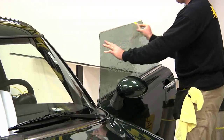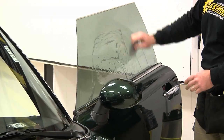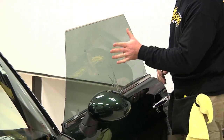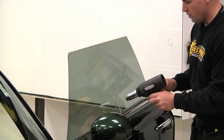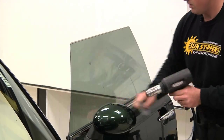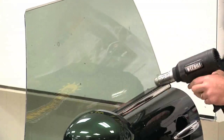I'm going to create what is called tension in the film — in the industry it's called a finger because it comes up from the bottom and kind of points up. The film is a flat surface that comes out of the box, and it has to fit onto the glass, which is normally a curved surface. These heat guns do what is called a mold — it actually molds the film, almost shrink wrapping it to the glass, and now you see it fits flat.